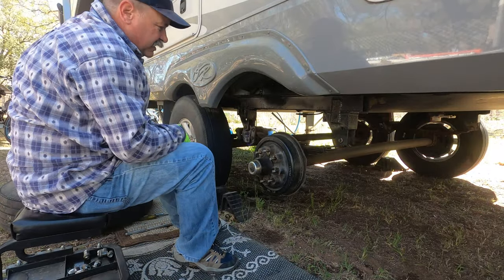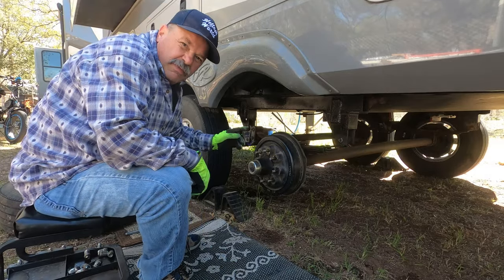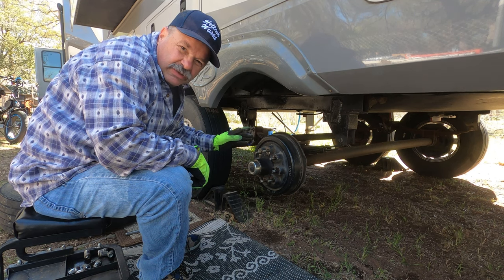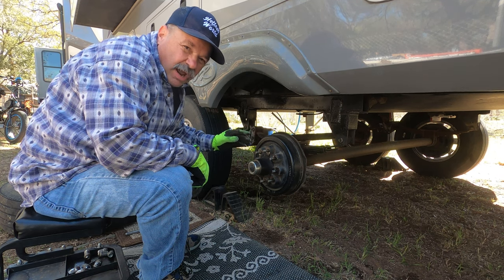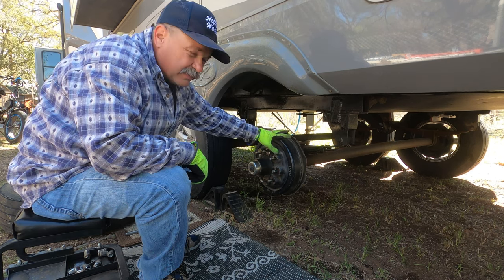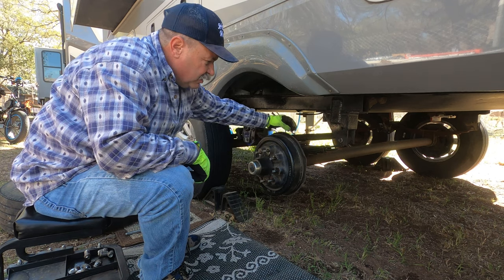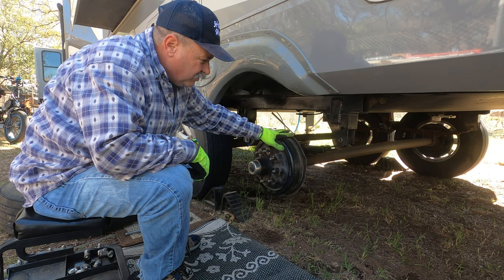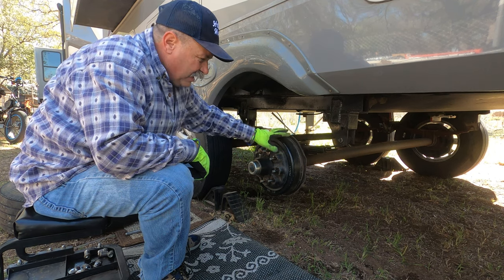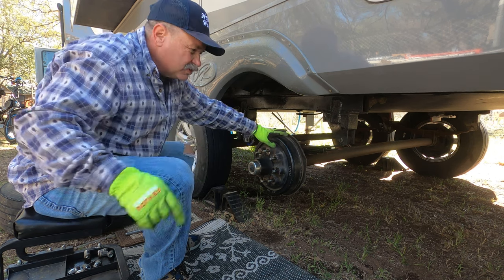All right. So what I'm going to do — I got this tire off. Now, manufacturers always recommend to never jack on the axle, and I make a habit of that. I'm not going to be jacking on the axle. As you can see, the weight of the suspension is already off. I'm going to use a bottle jack underneath the axle, centered where the U-bolts are, to basically support the axle when I get everything undone, and then utilize it to fit everything back up where it's supposed to be.